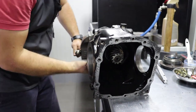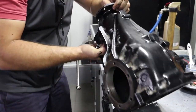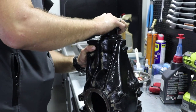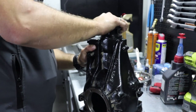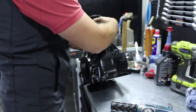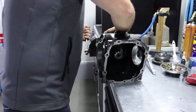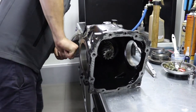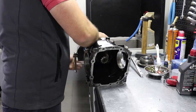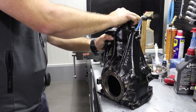Let's check pinion torque resistance. It is important measure. I feel under my hand a little bit more of axial free play. So I'm gonna tighten once more 5 degrees and then check for the torque resistance of the pinion shaft. I believe we are now ready for the measuring. Yes. No free play.